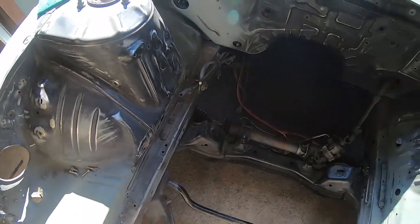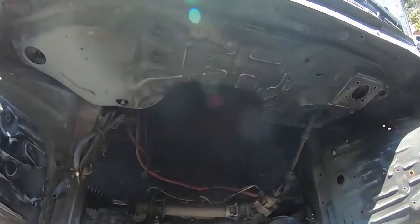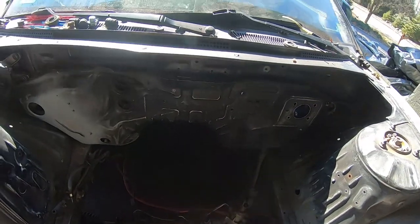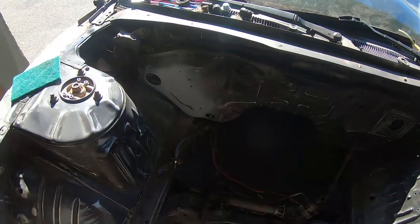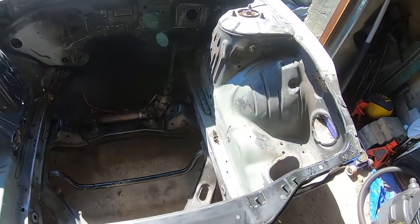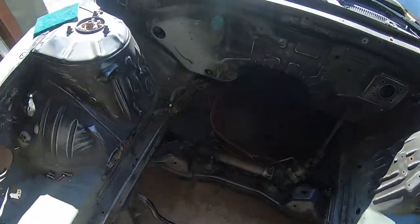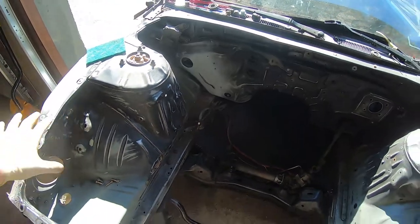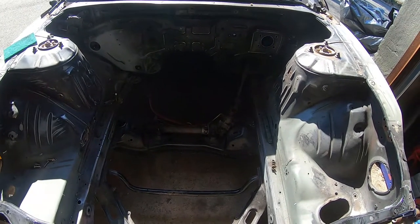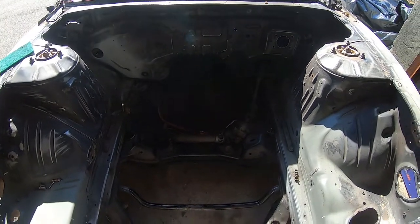I've gone over about 60% of the engine bay with sandpaper - you can see a lot of the scratch marks from about 180 grit, so a little rough. I just wanted to dig into the paint as best I can. I'll go over the whole engine bay and core support with scotch-brite to get it ready for primer. I'm going to do self-etching primer on the whole engine bay since there are a lot of bare metal spots, then a filler primer to get rid of some scratches.